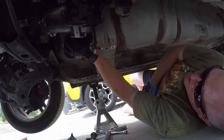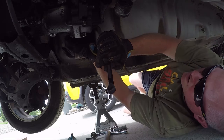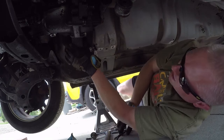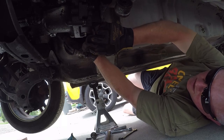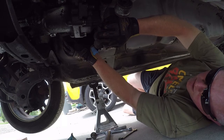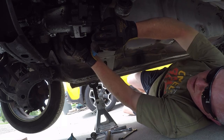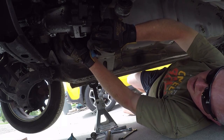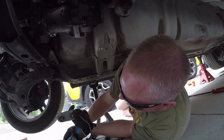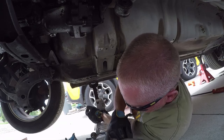Clutch is working great. Unfortunately, the rear main seal that I installed, I think I may have set it too deep, or it may have got cocked somewhere in there, because about 3 miles into driving it home, it started leaking oil pretty bad. Pretty sure it was coming from that area, the way it looked.